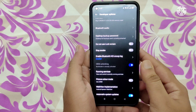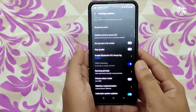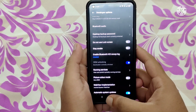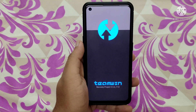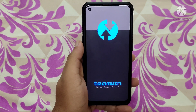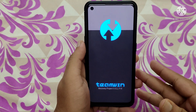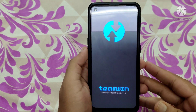To root your Realme X7 Max, the bootloader should be unlocked, and after that we just need to flash Magisk through the TWRP recovery. Right now I am in the TWRP recovery — I've connected my mobile phone to the PC and run the command to redirect to TWRP recovery.